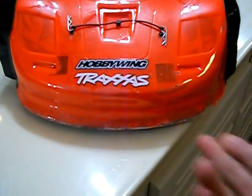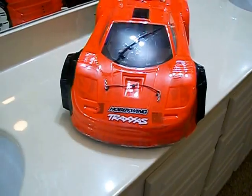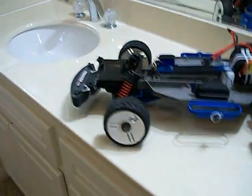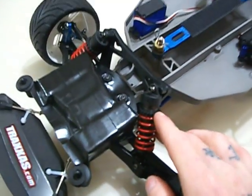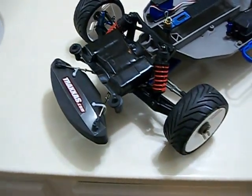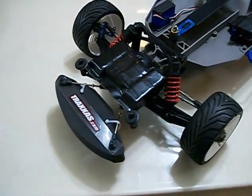You can see the nose does drag, but not during speed — it's only under deceleration. When I hit the brakes, it drops back down. That's why it's got some chips and marks there, but that's during braking, not during the run. I softened up the front springs a little bit, did a couple of turns out to make the front end a little softer, so that would help during aerodynamics to keep that body as low to the ground as possible.